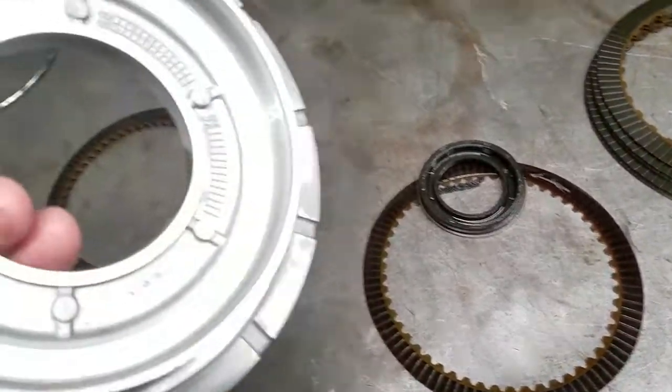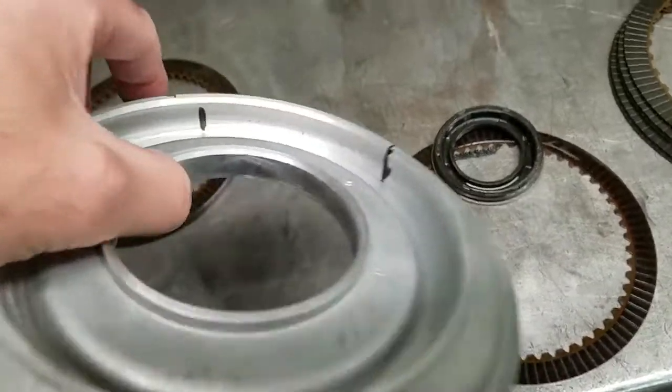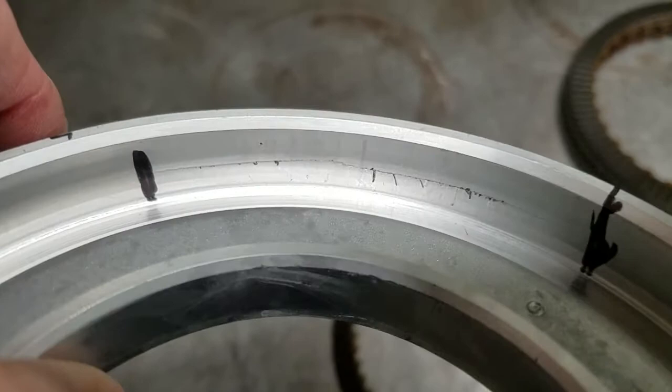The culprit here: these pistons are a very, very problematic piston. It looks like you've highlighted where it was cracked. This crack caused a hydraulic leak, and that hydraulic leak basically decimated the clutches.